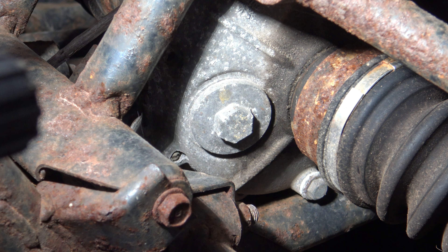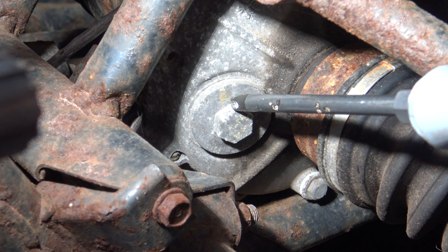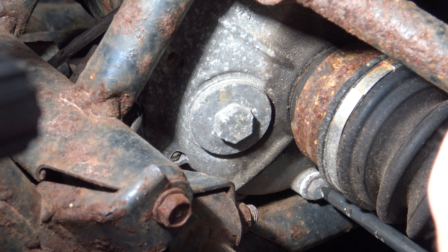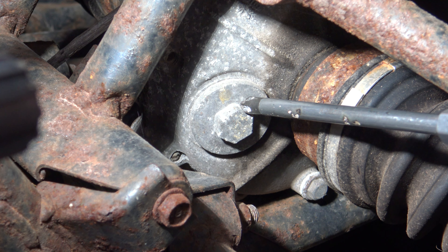If you're sitting on your ATV, it's going to be the left side front that's the area we're going to be working. There are two bolts we're going to be dealing with. This is going to be your fill hole right here, and this is your drain hole. The drain hole takes a 10 millimeter, and the fill hole is going to take a 17 millimeter.